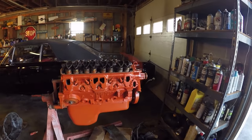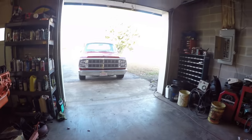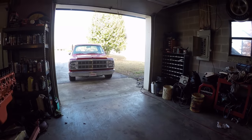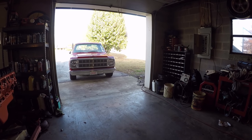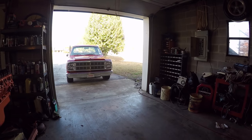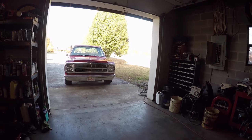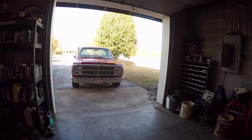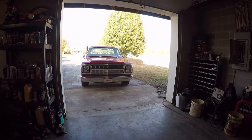I just picked up some motor mounts. Right now I'm going to get my truck in here and put some spark plugs, plug wires, cap, rotor, and everything in it — see if I can actually make it run a little bit better. It's got a little bit of a miss at certain points, so I think fixing some of this stuff might actually help it out.